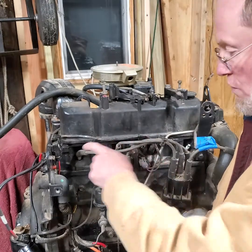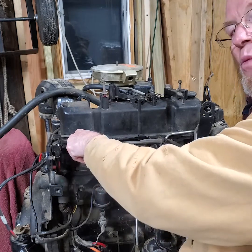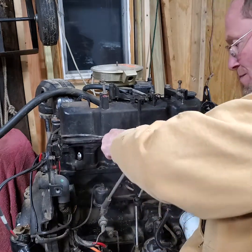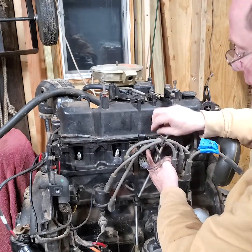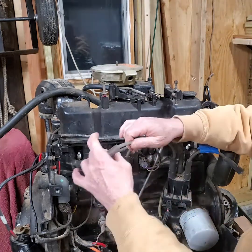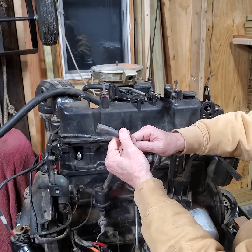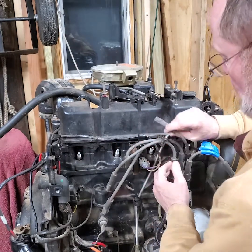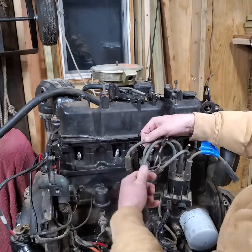The second thing you want to do is take all the spark plug wires and twist them — twist them back and forth until you break them loose from the spark plug. That way you don't rip the rubber or damage the insert. Twist them good, take them, twist until they come off — twist and pull. The last spark plug being the hardest to reach is always the difficult one. Whatever you do, never pull on the wire itself — always grab the boot and pull on the boot. Don't use pliers if you can help it; you're going to damage the rubber insulation.